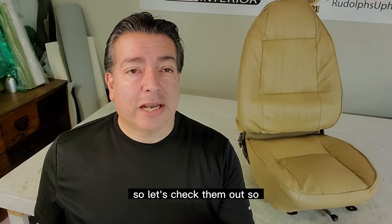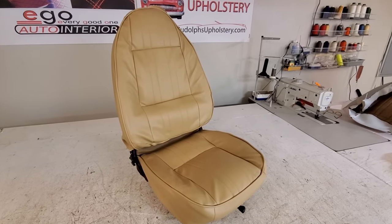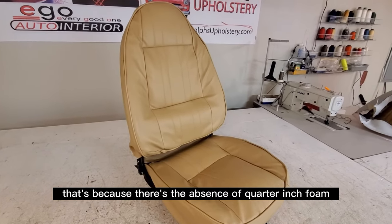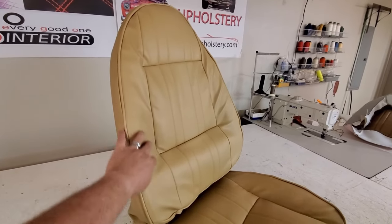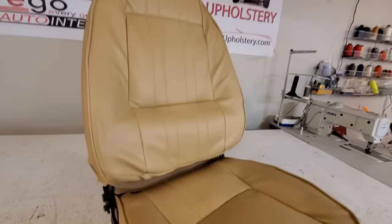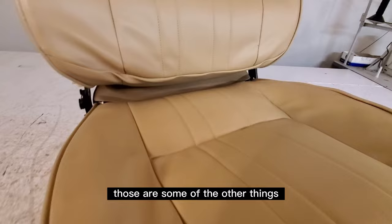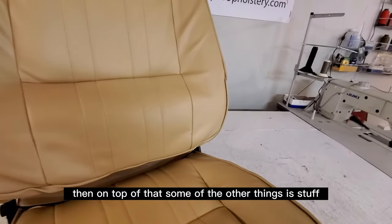Let's go through these items quickly. The first thing you'll probably notice is the wrinkles — that's because of the absence of quarter-inch foam or even half-inch foam behind the vinyl. On top of that, all the patterns are wrong. You'll also notice the gap between the backrest and the bottom cushion.